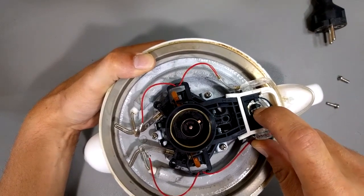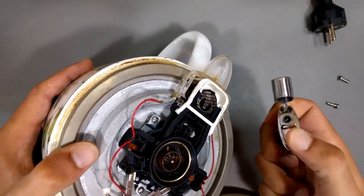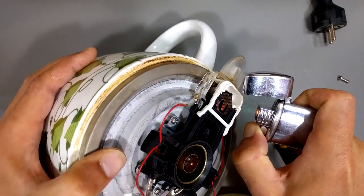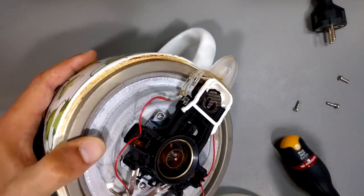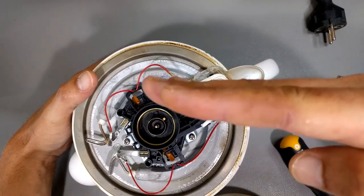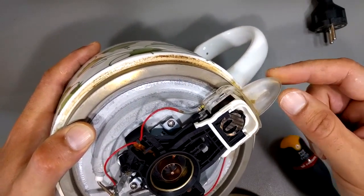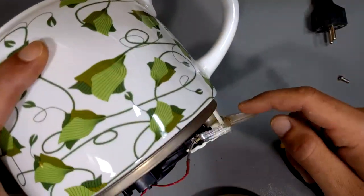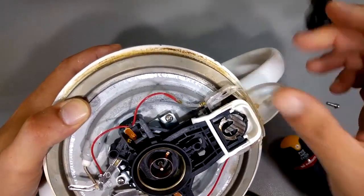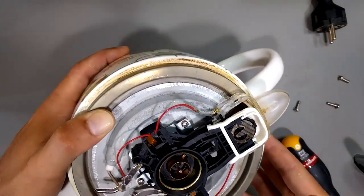That's kind of the secret as to how it turns off, because this is actually a bimetallic strip. You'll notice that this piece bends. What it just did is — normally it's like this, and when you heat it it goes 'boink' and it pops. If the switch is down, you push the switch down to turn it on, and when that bimetallic strip bends, the little piece of metal pops the switch back up. So basically the way it turns off is a bimetallic strip — but what the heck is a bimetallic strip?